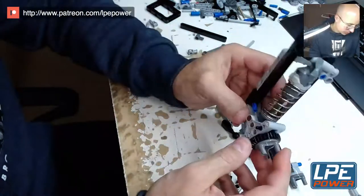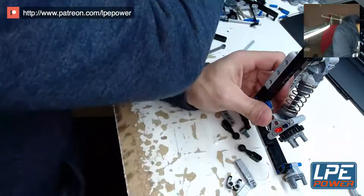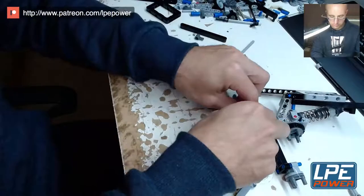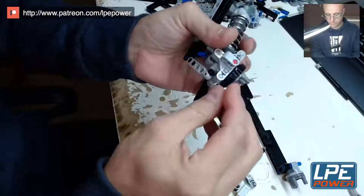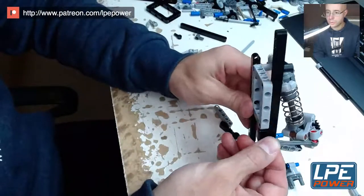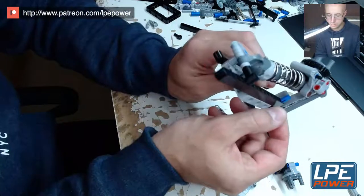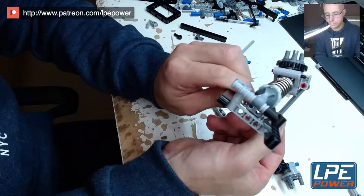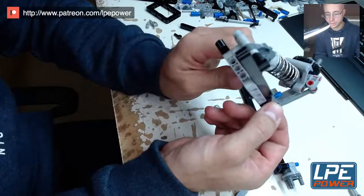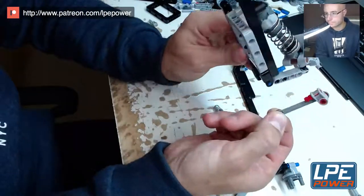Yeah. So one other option would be, of course, that we put the steering link here. Here, and here it would be okay. At full drop it would be interfering. So at full drop of the suspension we would not be able to steer, which is not good, because this is exactly where the inner wheel is, which is unloaded in the corner, and we don't want this to happen.